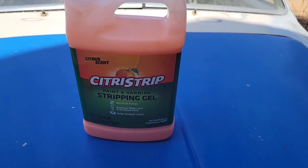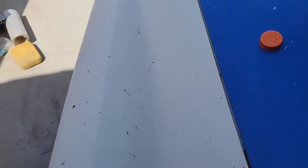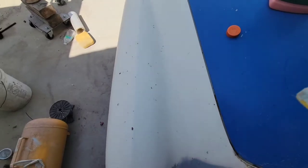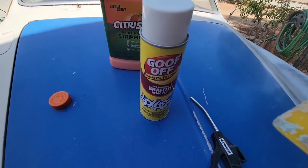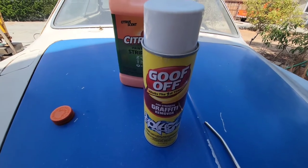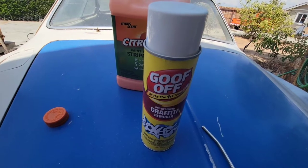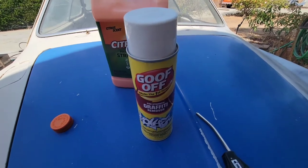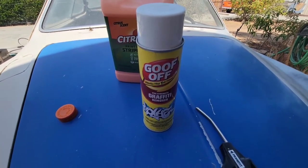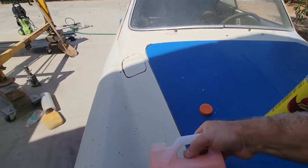Most of us know this stuff is not as strong as a regular stripper. What I've got here is an old car with synthetic enamel on it. Maybe you're wondering if this stuff will strip that off. I tried this product — some people say you can use it to remove over-paint and strip down to original — but it started stripping off the original paint underneath, so I wasn't able to do that with regular stripper. Since this is a mild stripper, maybe it'll work, so let's give it a shot.